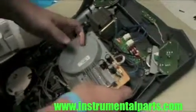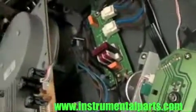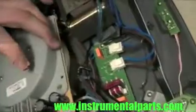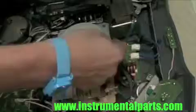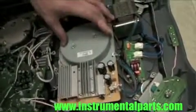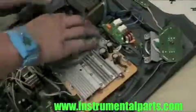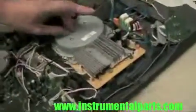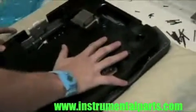You're going to make sure that these line up inside the holes. Once you have it down, make sure that you look underneath and make sure none of these wires are tangled or anywhere near the motor. Now that you've got everything in, make sure there are no wires underneath where the board sits and that it's sitting okay. You might even want to turn it around and look at the other side to make sure there are no wires up underneath where the spindle goes.